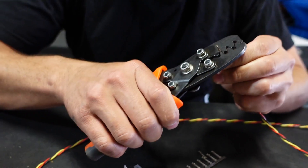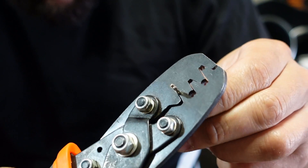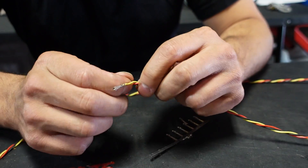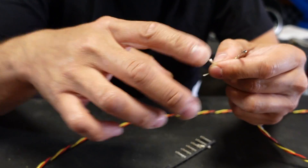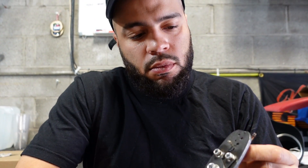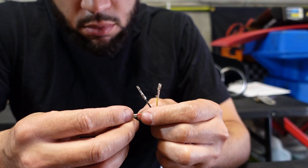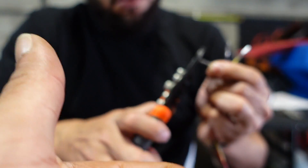What's the plan here, Trappy? I just got fed up of us going back and forth looking for this issue. I'm just going to run it — run map signal, power, ground straight from the ECU. So there's no doubts in anything. There could have been a chance I mixed something up, but I'm eliminating that variable right now. We're basically going to make our own separate harness straight from the ECU to the map sensor and see if we get rid of that issue. We're going to take those three pins and pin them straight to the ECU — five volt, ground, signal.